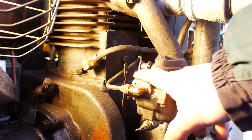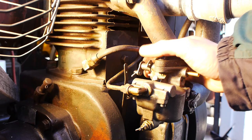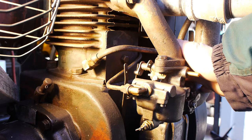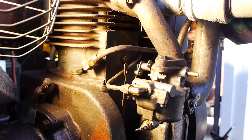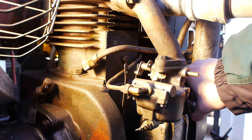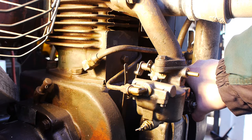Once that's set, you can usually find what RPM that corresponds to in your Wisconsin manual. If you don't have one, you can do it by ear or with a handheld mechanical tach. Next, you want to check the slack in the chain. There is a fine chain which Wisconsin has for their stationary engines, which goes to a lever you can see moving behind the air filter. When running a stiffer spring for higher RPM, you may need to remove one or more links from this chain to get adequate spring tension to stop surging at speed. If it's running in decent order, the number of chain links you have is usually correct.